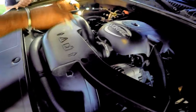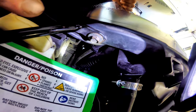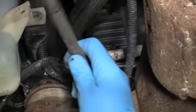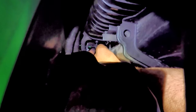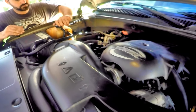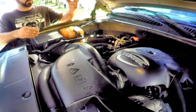To get access to the front of the engine we need to take out the intake and the upper shroud. But before we begin, we start draining the radiator fluid. There's a hose clipped to the top of the radiator on the driver side that needs to be unclipped and made to hang down to the bottom of the vehicle — have a pan ready when you open the petcock valve. Make sure the top is off the coolant reservoir; it makes the radiator drain faster.